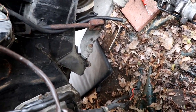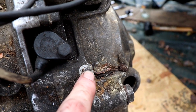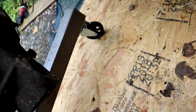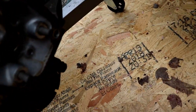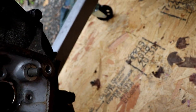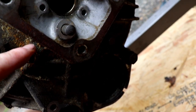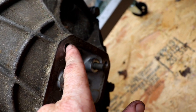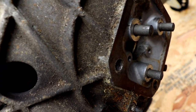There are two grounds right here that you need to disconnect, and your two wiring harness holders — the top one is here and the bottom one is right here. The four bolts on the back that connect to your torque tube: this one's a tough one to get to, so it takes a while. These two are pretty easy. The slave cylinder is in the way because it's right here, starter is down here. So you get the slave cylinder out of the way, then you get to this one, and you've got to pull your oxygen sensor off your exhaust to get the exhaust out of the way for this one. And then this last one you can get to, but you've got to turn it an eighth of a turn at a time.